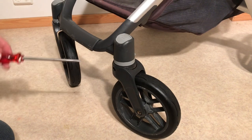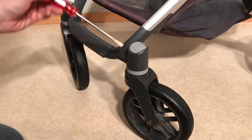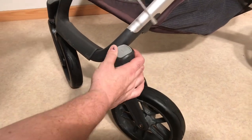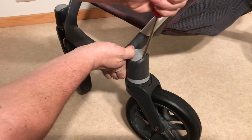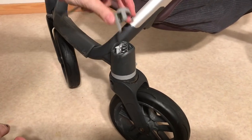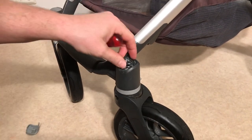In order to hammer out this wheel, the best thing to do is to partially disassemble the top part of the mechanism. Take a flathead screwdriver and dig it in on the sides of the swivel lock button and pry it up on both sides, being careful not to break these pegs. Feel with your fingers as you go, then take that piece off.